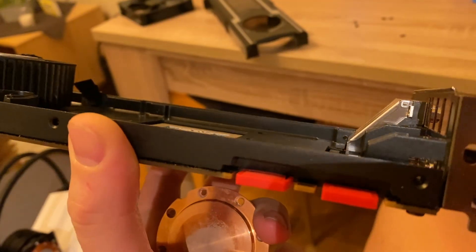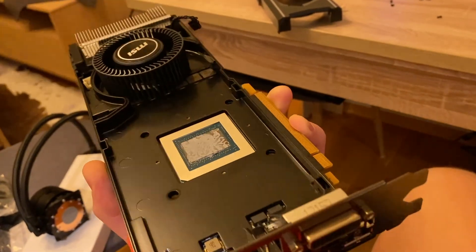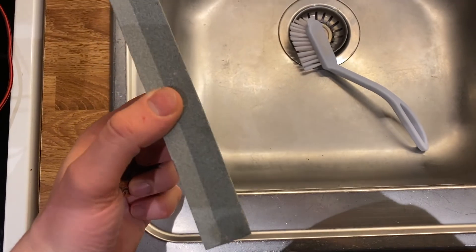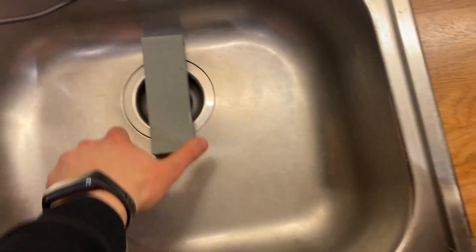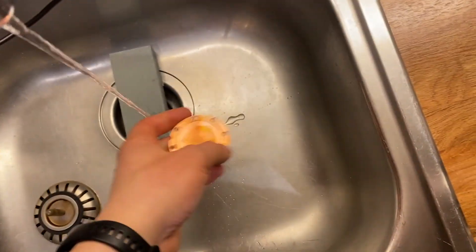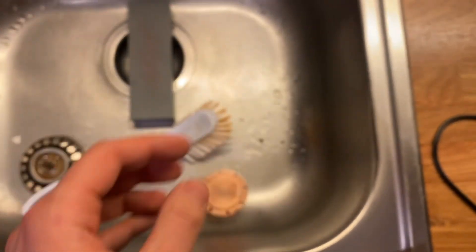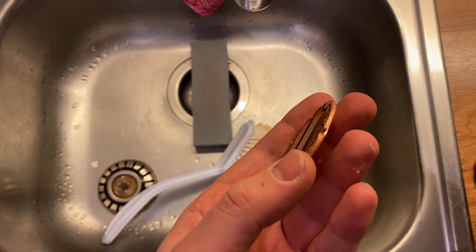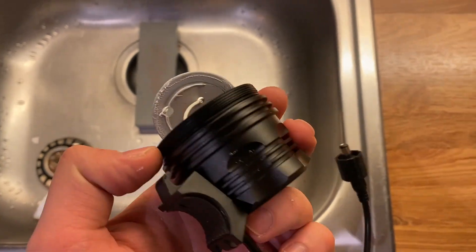I was thinking of using the plate from the old cooler as a kind of shroud or spacer, since you can't mount a new cooler directly because the GPU die is underneath that plate. I thought of grinding off the cooling fins on the back since it's copper and fairly soft — but that turned out to be a huge failure. Even after a long time, copper isn't as soft as I believed it to be.